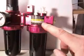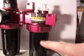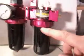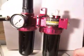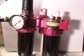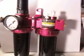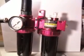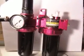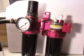One of the reasons we bought it was to try to do the oiling. We were going to put some fuel injection cleaner lube in here to keep the injectors lubed up and clean, as well as it's supposed to lube the top of the cylinder head — like the valves and stuff. So we're going to compensate for the fact that it won't be running gas; we need to have some kind of upper lube on that stuff, like they do on air compressors.